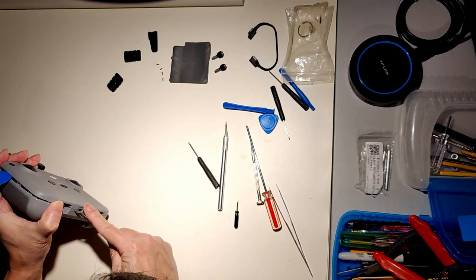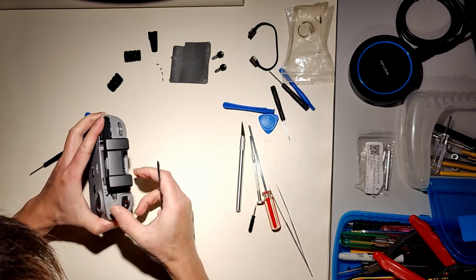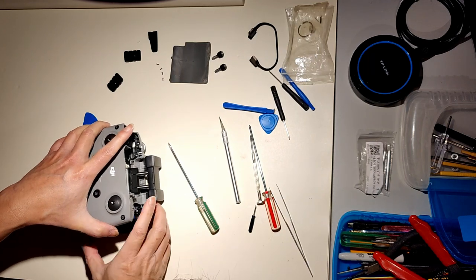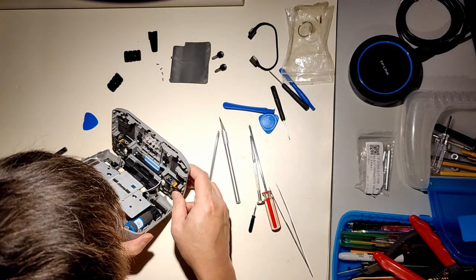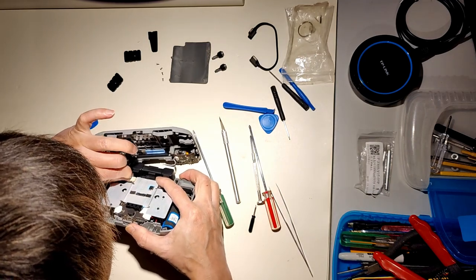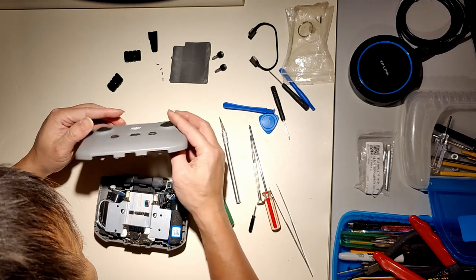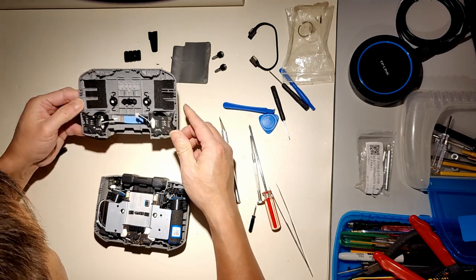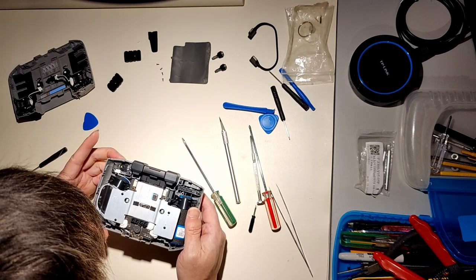You can probably put something to hold the opened area and work on the other edges. There you go — let's see what's inside. There are two wire plugs for the joystick on the upper part of the cover; remove those. That's pretty much it on the upper part: the joystick and two buttons. The gimbal wheel is just a potentiometer.